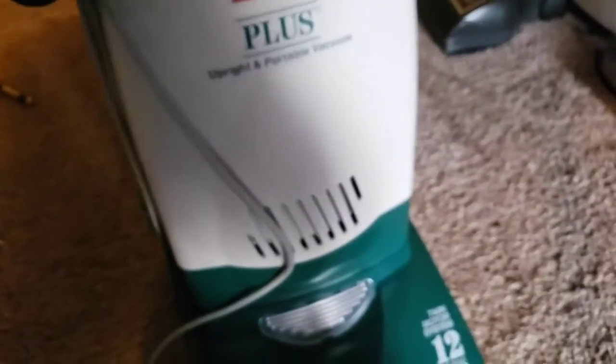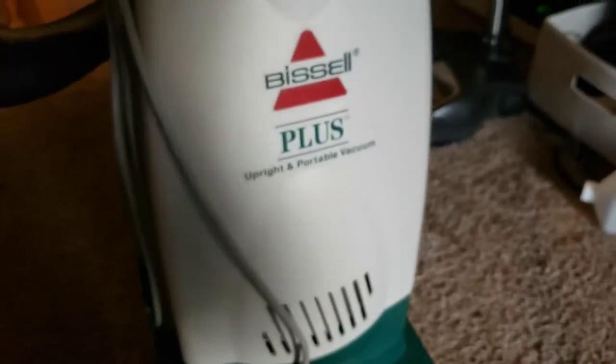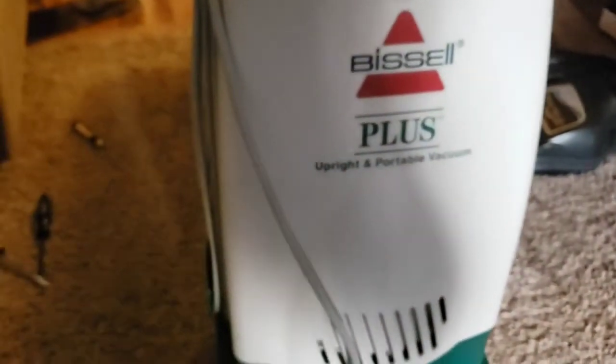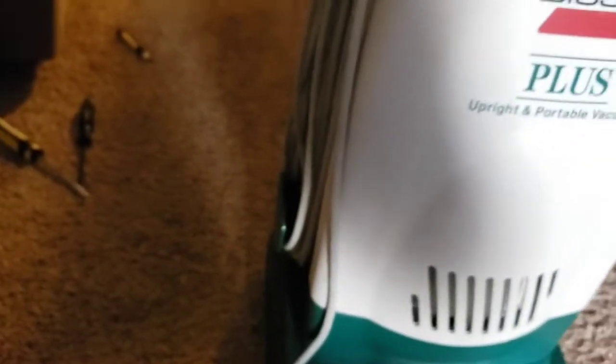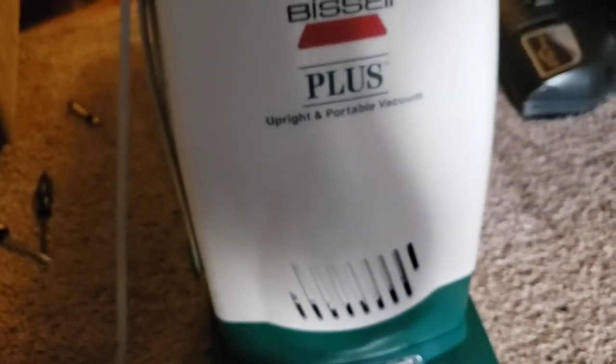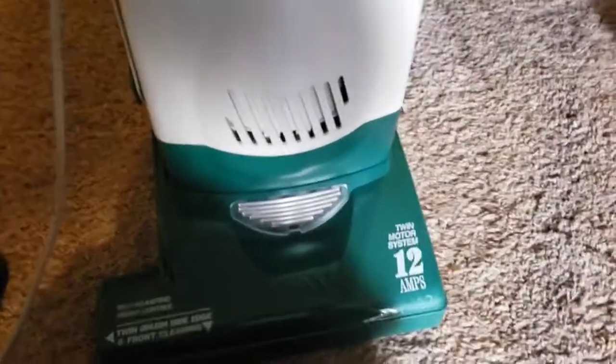And while I've considered trying to seal up some of those plates, I didn't dare, because when we seal this off, sealing it off already causes the bag door to kind of cave into itself, and I think that making that any worse by sealing off those plates could potentially result in a crack, much like we see on the higher amperage Dirt Devil Deluxe style machines, or MVPs. So I'm just going to leave it alone, and it's just going to stay as is.